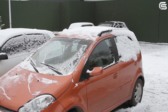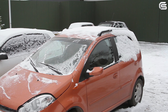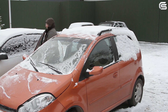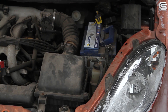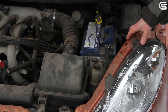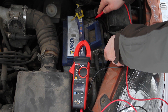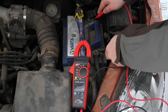Let's open the hood and see what's underneath. Not too easy to be a car driver in winter. A 1.3 liter petrol engine is installed in this car. The battery is right here. I'll use a multimeter to get at least a somewhat of impression about its condition. Let's check the voltage — 3.7 volts. It's obvious now why we can't start the car. This won't be an easy job for the jump starter, but we are going to try anyway.